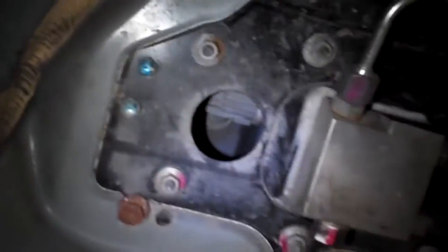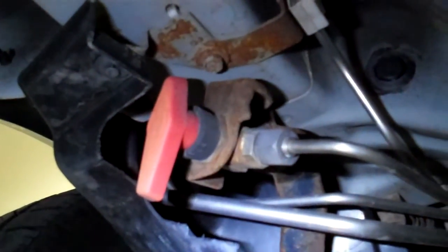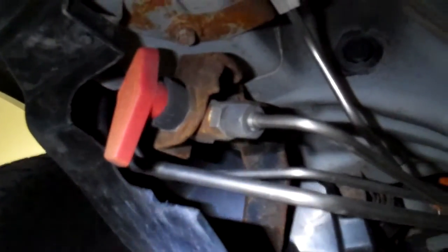Here's the location of those other bolts for the mounting frame. There are also screws and clips that go in some other locations, but somebody's already ripped them off so I don't know what to tell you. That's how you do it. Basically, the most important thing is to turn the valve off first, run the vehicle out of gas — basically run it until it dies — and then open that little 6mm Allen bolt at the bottom of the filter. And then after you do that, take that off. That's how you do it.